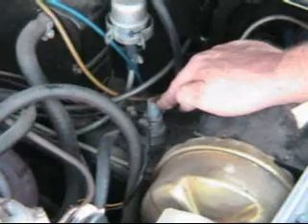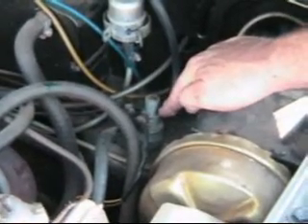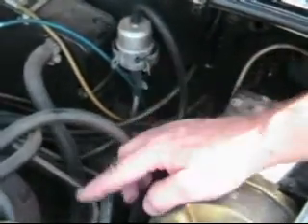I'm surprised this one is even yet on the car. Disconnect the rollover valve — it is not safe. Go directly from the top of the fuel filter right down to the carburetor. That's today's hint — it has to do with the rollover valve.